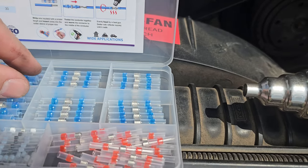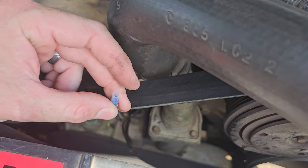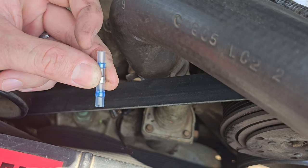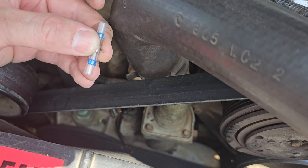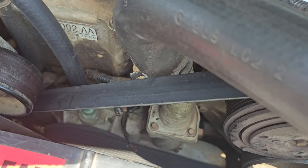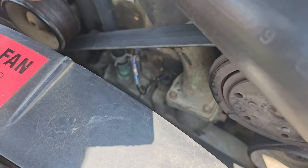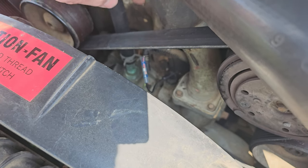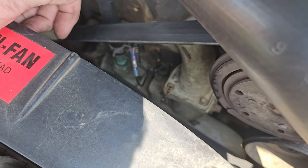So we'll take one of these. I'm going to slide it over that sensor wire and then kind of fray the two ends together — kind of splice it. Then I'll move this sleeve back over it. I believe the process is to hit the blue ends first to kind of seal it up, and then you want to hit the solder and let it do its thing — the solder should be the last thing. I'm going to try to set y'all up to see this, but it's a very tight space. As you can tell, I've kind of just spliced those together by hand and slowly slid the sleeve back over it. The solder is sitting over the joint with the blue ends on each side of the wire. We're going to hit it with the heat gun now and see what happens.